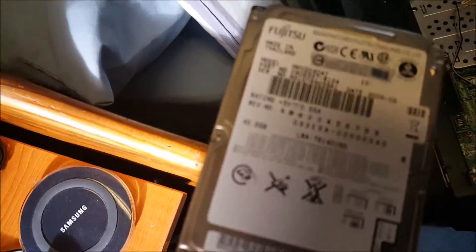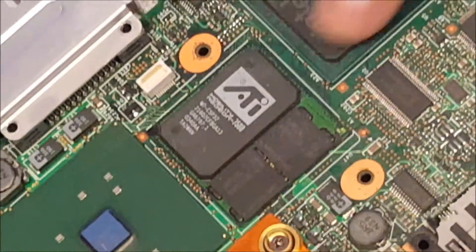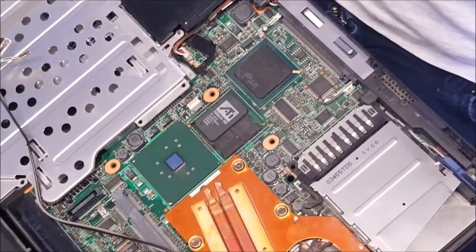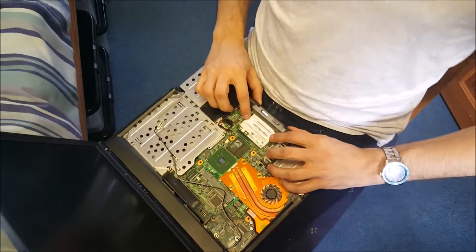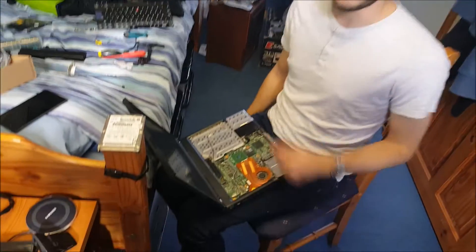Right, knock it off. It's probably time. It's either this GPU or the Southbridge that needs reflowing. I was an idiot - when I tested it the WiFi card was in there, so I figured it could only be one of those two chips and deemed it was the GPU. Let's lift this up - brilliant, there you go. It's probably that one.